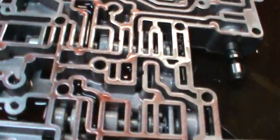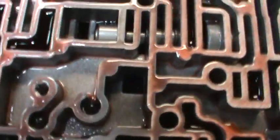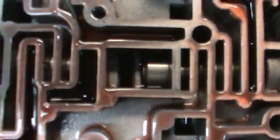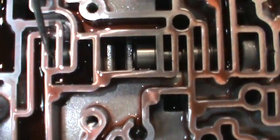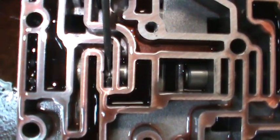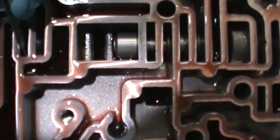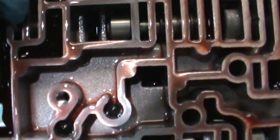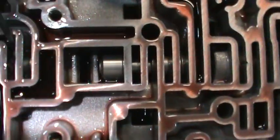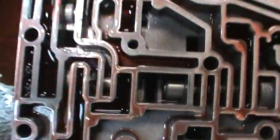I'm going to show you where the fault itself lies. I actually thought it may have been the servo not being able to move, but that's not the case. It's actually a piece of the clip that falls out and jams one of the spools, not allowing it to go into overdrive. Right there — I'm going to try popping it out. You can see how it's jammed in the spool. I'll get a little pair of needle nose pliers and we'll pull that sucker out of there.